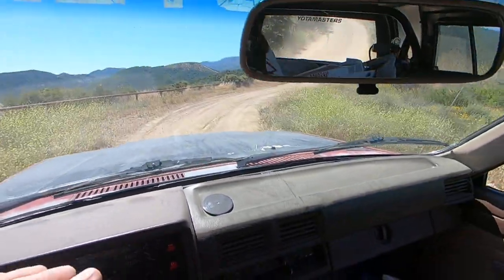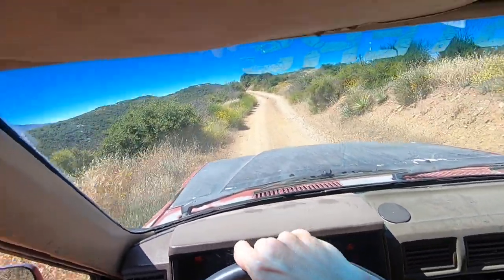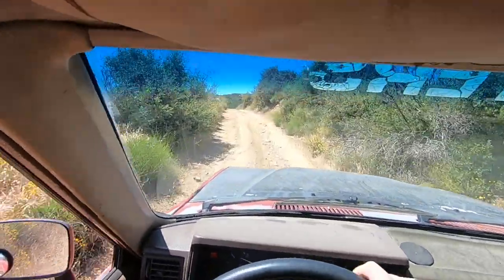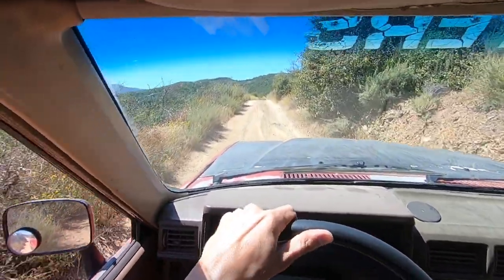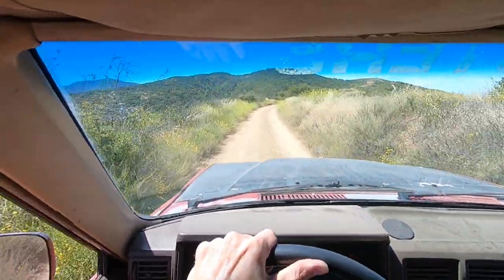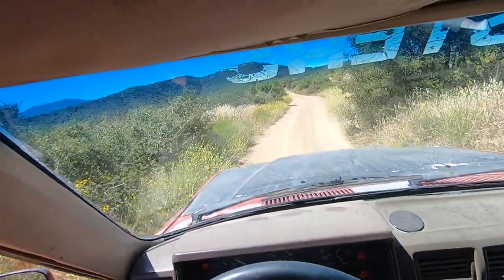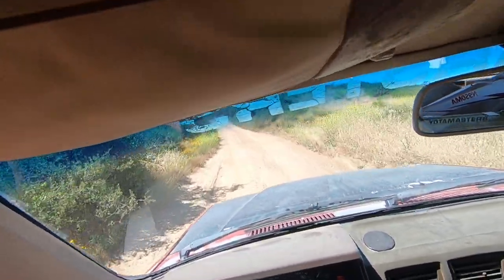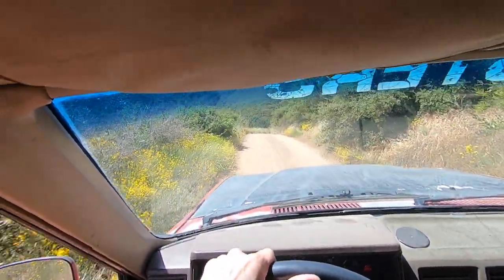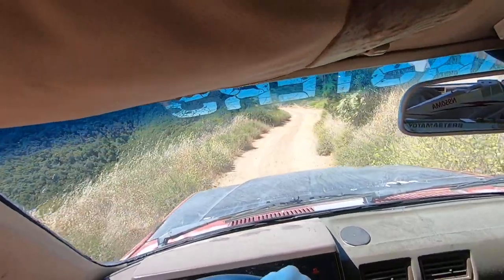Third gear, a little bit of crawl box, just taking it easy. I've got the tires at 20 psi. I do have to drive it down the highway a little bit, so I'm not going to worry about airing up — I don't need 15 or 10 for this. But letting some air out of these tires really helps with both the ride quality and also traction. It's like riding on plush marshmallows, especially when you've got a bunch of junk in the trunk, and it can really make the ride quality much better if you're going to be doing long periods of dirt road driving.